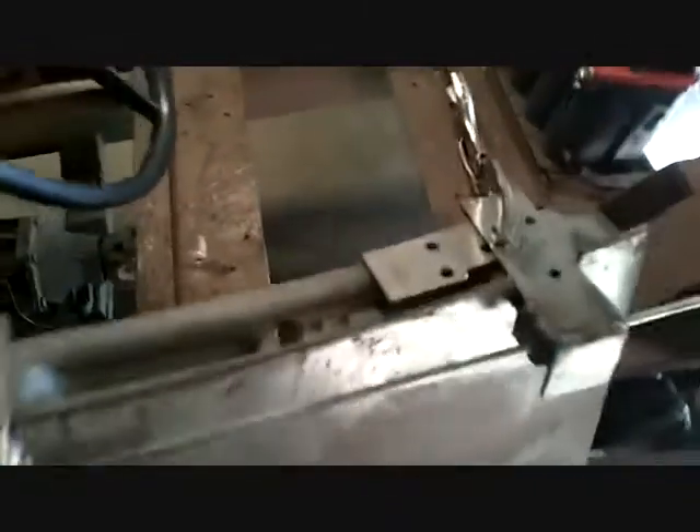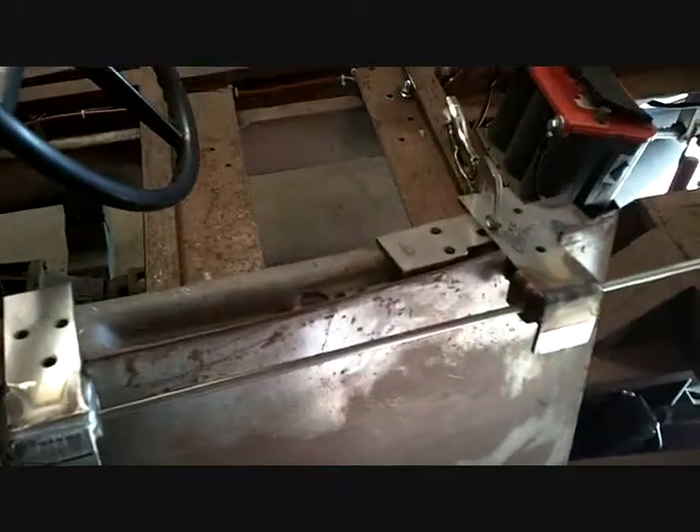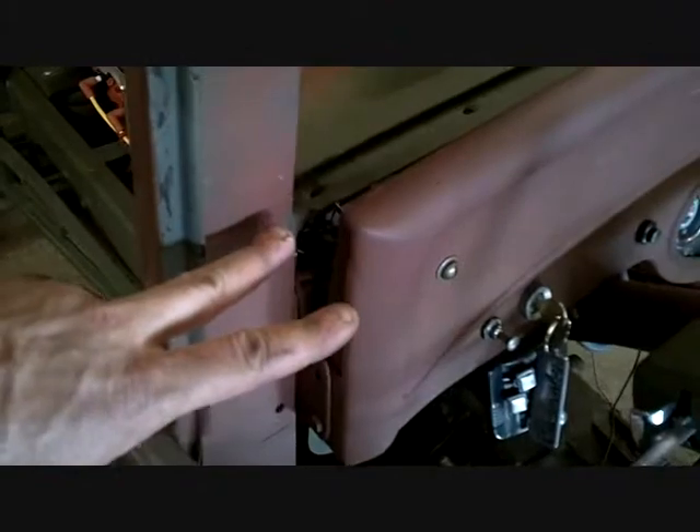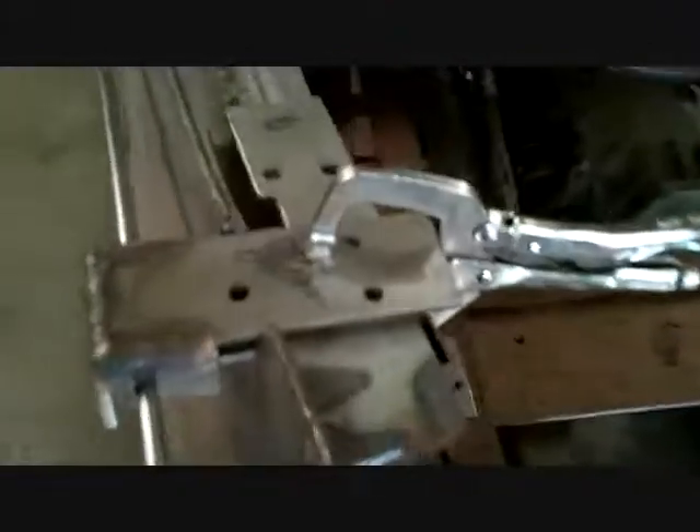Back to the real car. I have a long stainless quarter-inch rod — that's how I do my pin centering. I was trying to figure out the gap between this plate and the bottom plate, cause it's kind of weird — this one goes inside the door, and the other one goes outside of the frame. They don't exactly meet flat, they meet like in a V, so there's plenty of room for bolts. I figured out with a little creative clamping that I need this plate and this plate to be three-eighths of an inch away from each other.